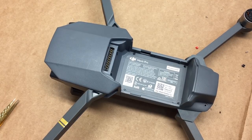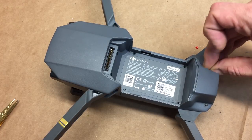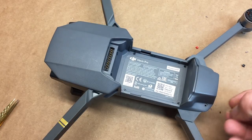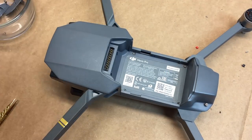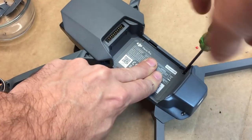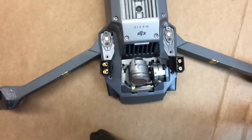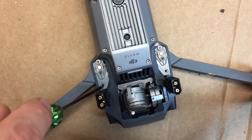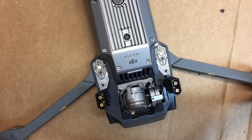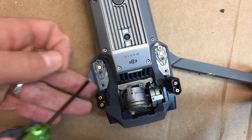Remember when we talked earlier, we have some shorter screws, we got some longer screws. So just make sure that you keep those two shorter screws out so that you don't put them in the wrong spot. You wanna make sure they go back in the panel cover on the outside. Okay, now flip it over and we can do the other screws here. Gonna do these two first. And at this point you should have only six screws left. There should be four long and two short.